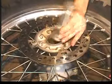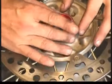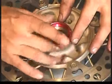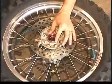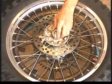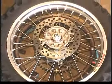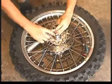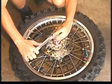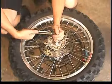The next step is to install the retainer ring that came with the kit — it's a beautiful anodized part. Just screw it in with your fingers until it gets tight. You can use the special tool, or very carefully use a punch, though we don't really recommend it. If you do use a punch, make sure you move from one notch to the next and distribute the load evenly. The important part is that you get the retainer ring tightened down to manufacturer specifications.